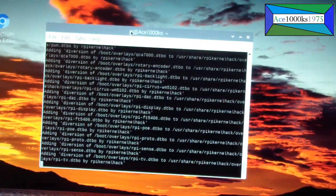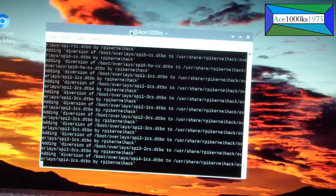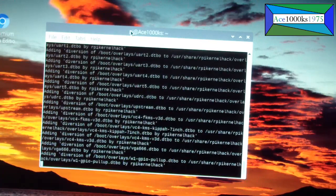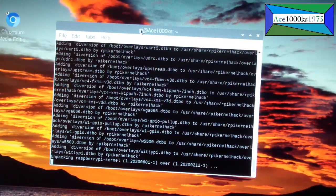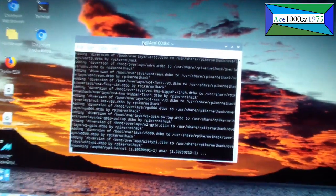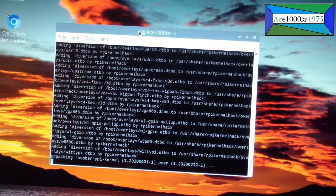But yeah, it doesn't require a lot of power, so probably at most if you put 2 hard drives in there and have 2 powered hard drive docks, it would use maybe 25 to 35 watts or something, which is a lot less than using a desktop computer, which would probably consume at least 200 watts or more, depending on the computer and depending on how many hard drives you have on it and graphics card and everything. It would cost a lot more money for you to use it.